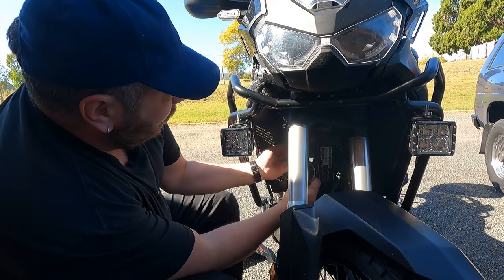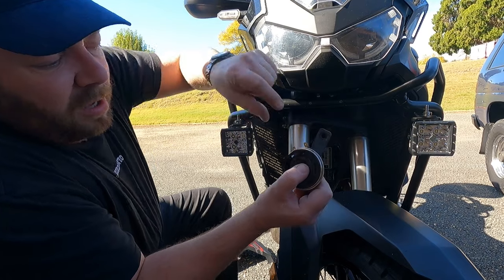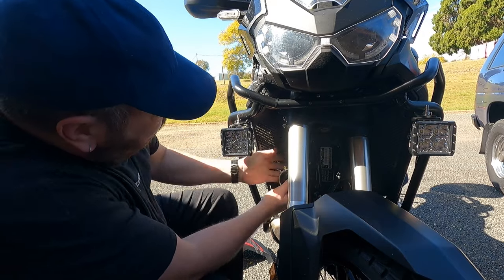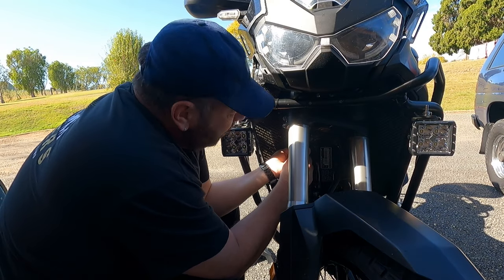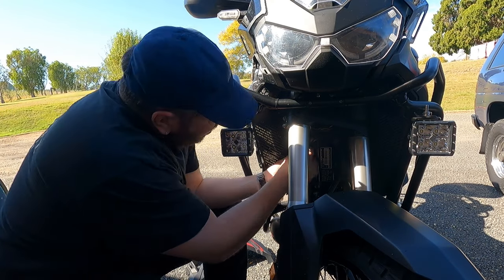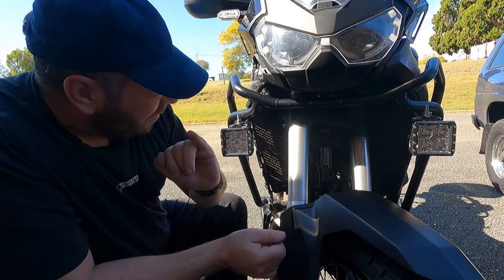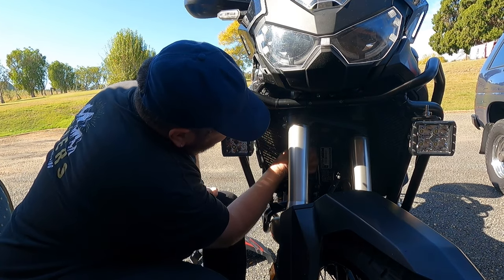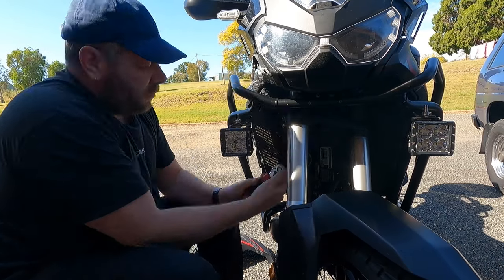First of all I'm going to plug the horn back in. These plugs are fairly easy to get off — if you pinch them on the sides and wiggle them left-right left-right and pull up, they just pop off, very simple. Slide them back on until they click, which means the hole's lined up. Make sure it's all lined up — there is a little finger that sticks out, which means the horn has to be slid down to lock into position — and it's on.